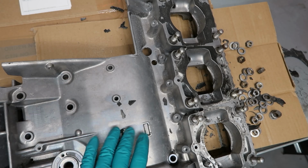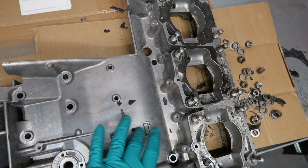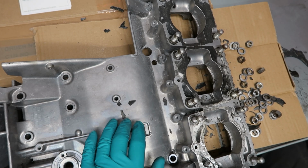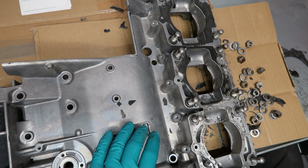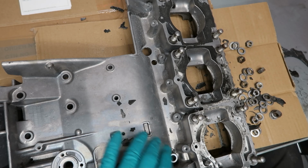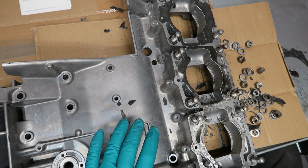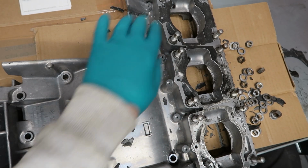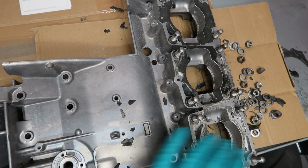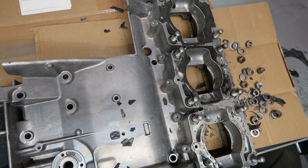I mean, you'll know this, but there are three different types of asbestos: the white, brown and blue, I think. And the really bad one is the blue one, and that's very rarely seen. I've never seen that. I don't think I've seen much brown asbestos. You sometimes get it in superheated steam gaskets, which operate at 500 degrees C. But I've seen quite a bit of white asbestos on older ships. It was used extensively for lagging and things like this. It can be added to gasket material, so it's very unlikely for this, but as you get towards the hotter end, say in the head gasket, it could have asbestos in it. So just be careful. If you're not sure, mask on, get everything clean. Most likely, if it is there, it's going to be the white, which is the least hazardous form. But just be careful.